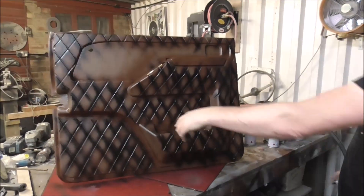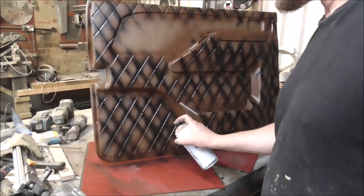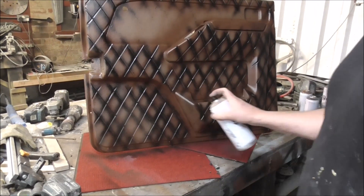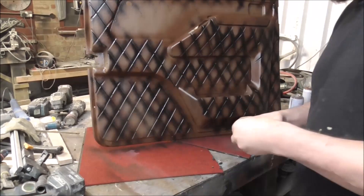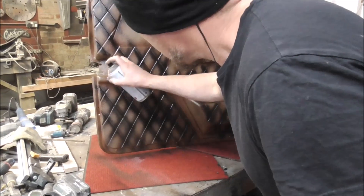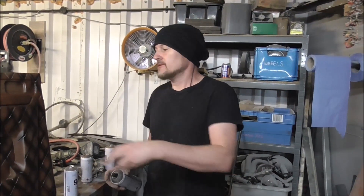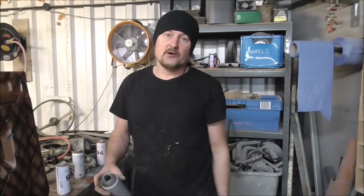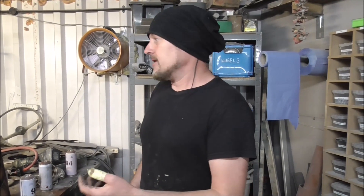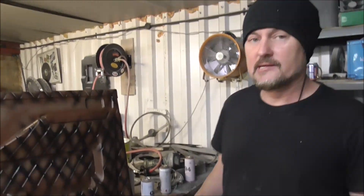You can see the black gives it a bit more depth, but I've gone a little heavy in one spot, so I'll come back in with the lighter colour to take a bit of that out, then add a little bit less black back in. With these cans - they're meant for graffiti so they're very low pressure - doing fine line work like this is a lot easier than it would be with a normal aerosol from the car accessory shop. Now for this panel, I'm going to do the armrest black, just painting it in by hand without masking.